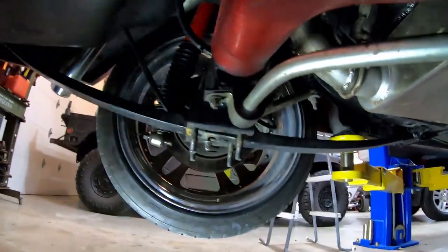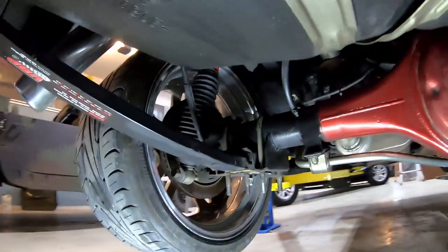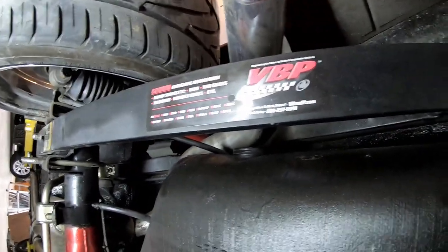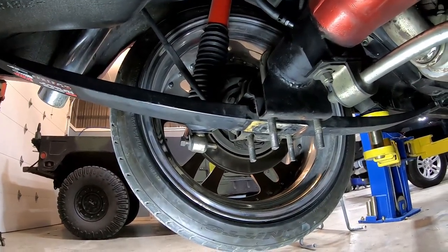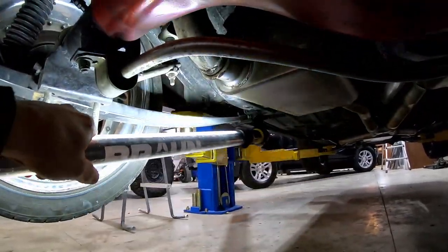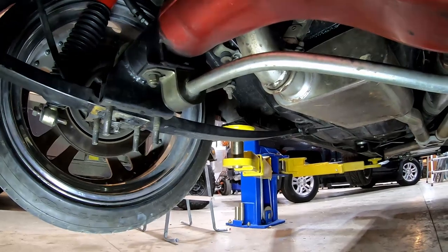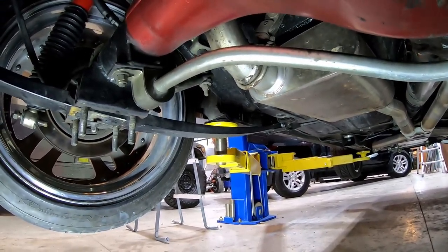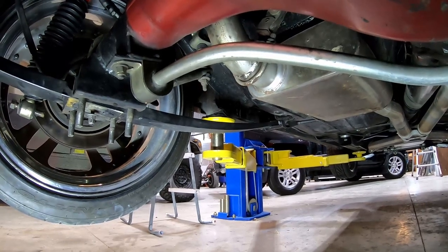Underneath the car, it currently rides on composite fiberglass springs purchased from a company called Vet Brakes and Products — unfortunately they're no longer in business. I installed these springs around 2004-2005 and they worked really well except for two problems. One was the bushings — the regular bushings that go in each end dried up and failed, and because Vet Brakes is out of business I couldn't get direct replacement bushings. I went to Energy Suspension and was able to get bushings that fit a Dodge Durango — those were as close as I could get and I pressed those in to solve that problem.